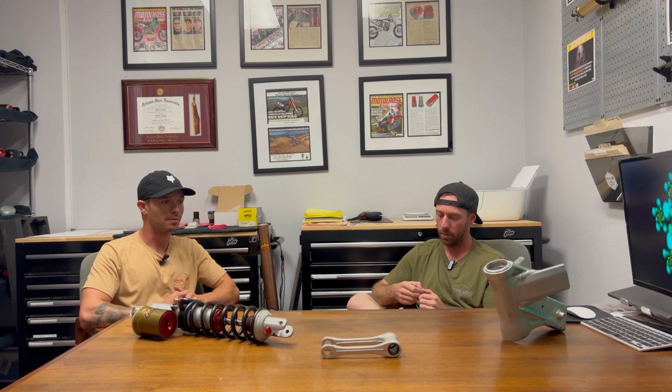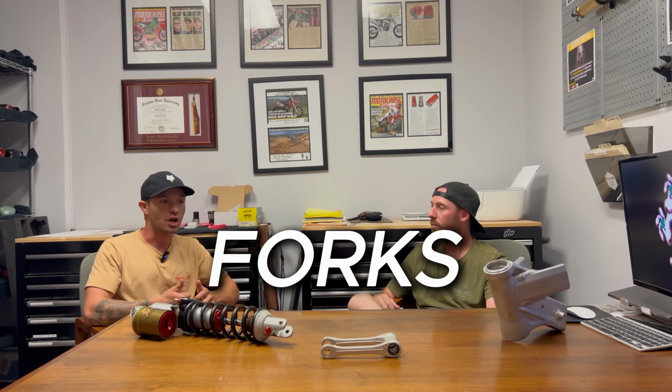So what are some things that come to your mind in terms of what you can adjust and what it will do, but what it may also affect elsewhere? A lot of people will say, oh, I get head shake on straight line stability. I'm at Glen Helen, there's a wide open straightaway, my bike wants a head shake. I want to speed up my rebound so my front wheel can follow the ground a little bit more. Well, how high or low are your forks pushed up through your triple clamps? For sure. Because just a general rule of thumb for you guys out there is, if your forks are pushed up through your clamps, you're going to cause more instability.